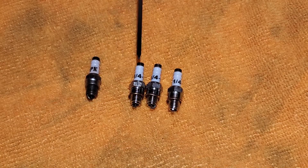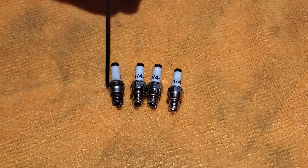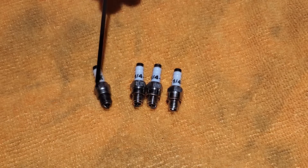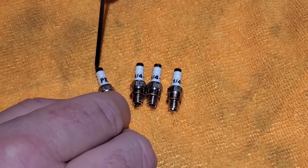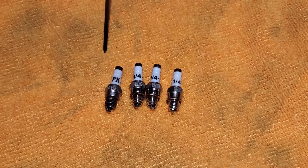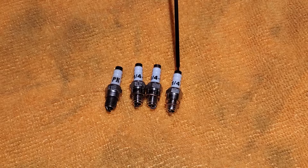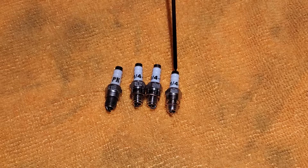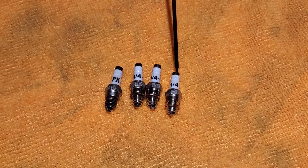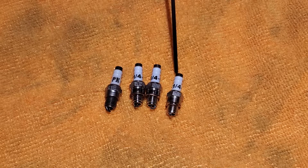I have a feeling that, much like many things in the modern world, all these plugs came from the same factory. The generic PK branded plugs are going to be quality control rejects from manufacturing the plugs for branded customers. RCEXL also offers an iridium plug — I haven't gotten one of those yet — but I'd guess that one should be different because the iridium electrode is going to be different on the inside, so they'd have noticeable differences from a unique manufacturing run.